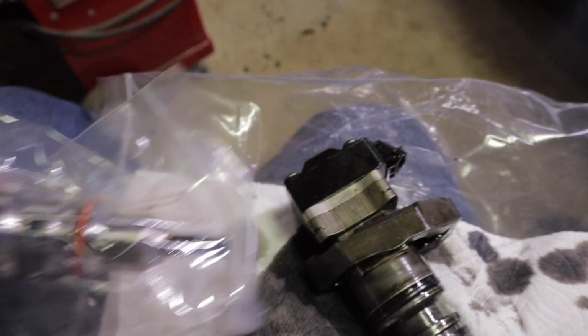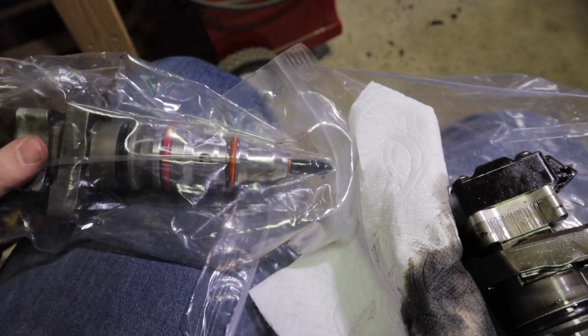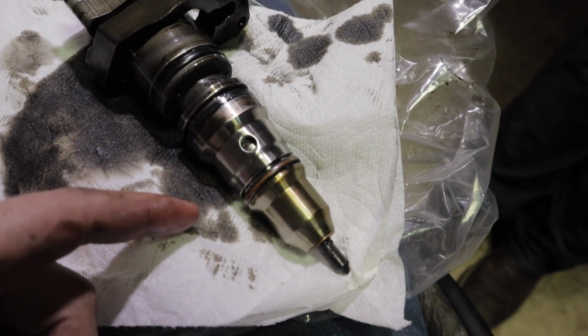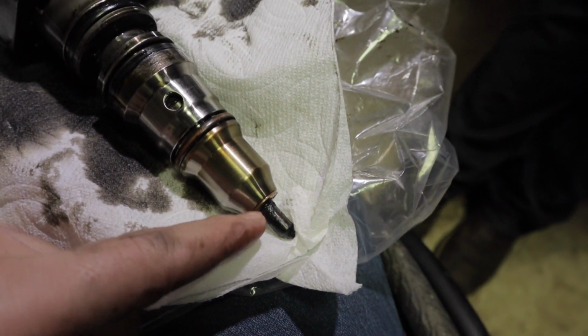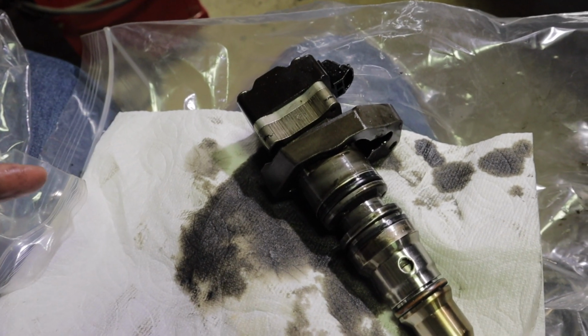205/80 injectors, hybrid injectors. I can go into more details on these at the end of the video, so we don't do all the talking now. But we're going to go through, check all the injector cups, make sure they all look good, seem to be in good condition. Make sure all the old injectors have the O-rings. And then what we're going to be doing is actually putting the new injectors in, leave the glow plugs out,